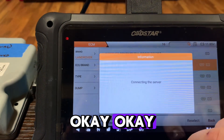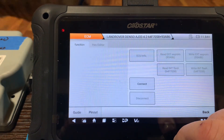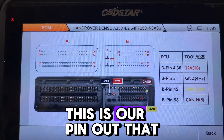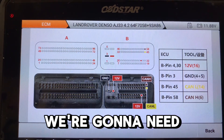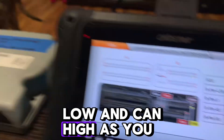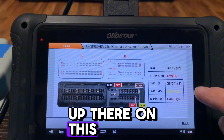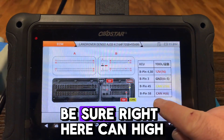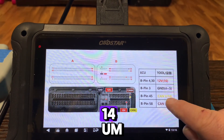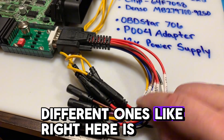Here's our adapter with the ignition switch. Go to pin out — this is our pin out that we're gonna need. We got two positives, ground, CAN low, and CAN high. As you can see, we got it hooked up there. Be sure right here: CAN high is pin 6, CAN low is pin 14 in this harness.